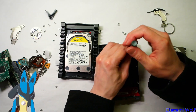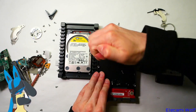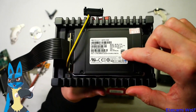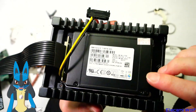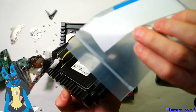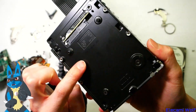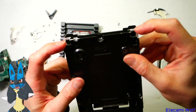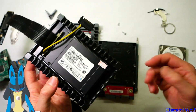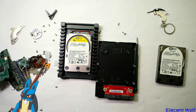The other day I mounted a solid state drive in one of these ice packs because it gets too hot. I had trouble finding screws that were the right length, so I should have just stolen them from one of these. This is a U.2 drive — Samsung PCIe 4, 7.68 terabyte. Draws about 20 watts so it gets quite hot, so I've put some thermal interface material under it and screwed it down into the same holder. But the screws I found were a bit dodgy and didn't have much thread engagement. You have to use exactly the right length screw, otherwise it's not going to work.